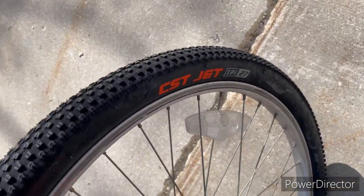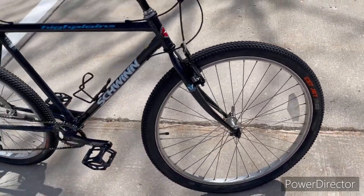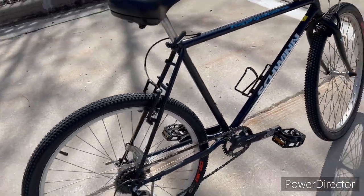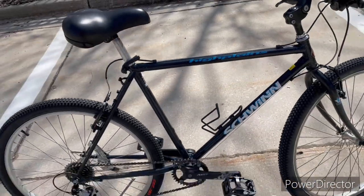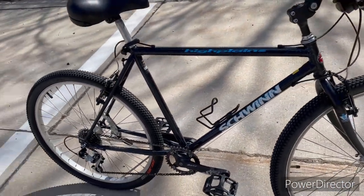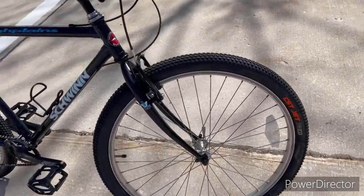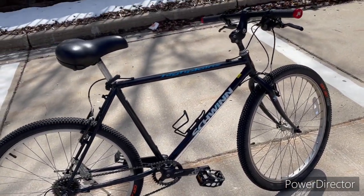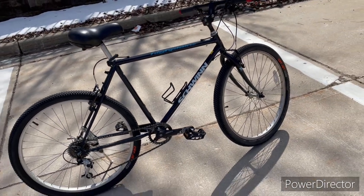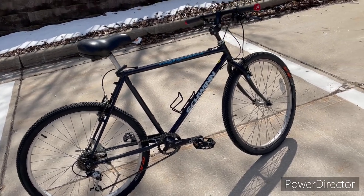You see a lot of CSTs on different bikes — they make road tires, mountain tires, all kinds. These are kind of multi-purpose, almost enduro-type tires. And again, chromoly frame all the way through — not just the rear triangle, but the front and rear triangle are both chromoly lugged. Really nice, resilient ride. No front suspension, but you do have a chromoly fork. For those who are particular about needing front suspension on a hardtail — if you haven't ridden a properly adjusted chromoly hardtail, it's a different world.